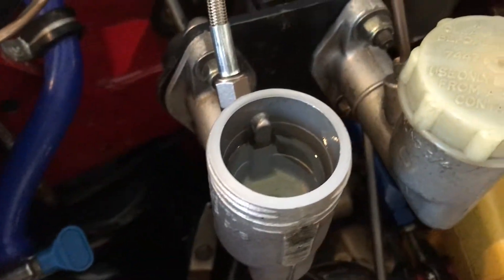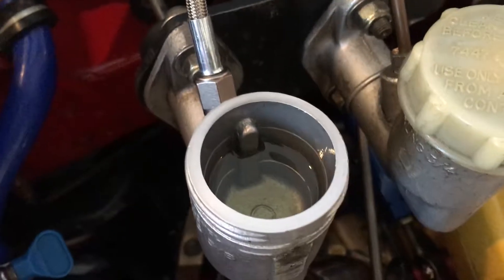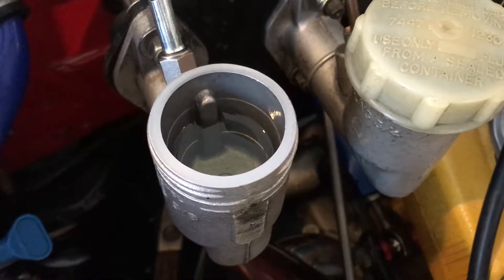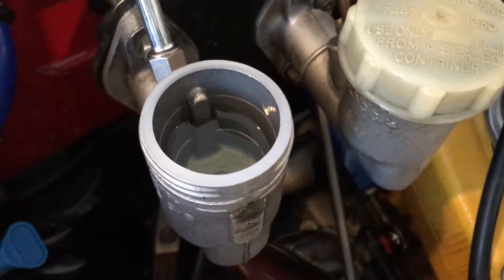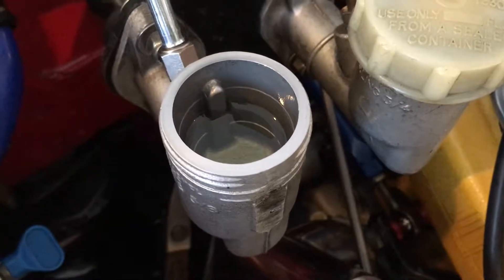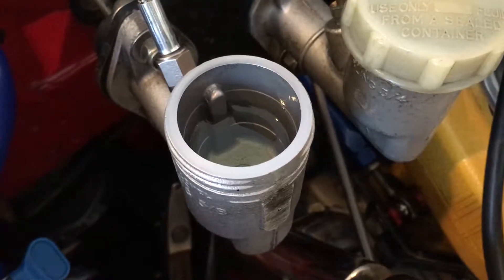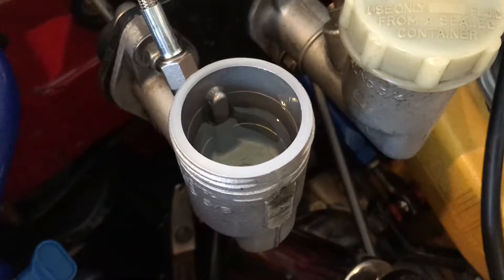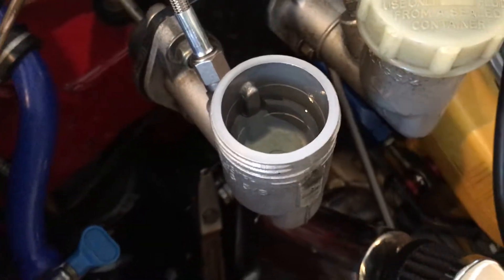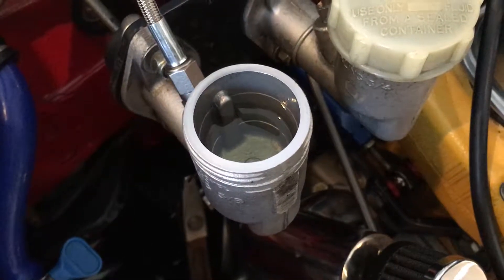I put the brake bias valve in line and now I'm bleeding the rear brakes. Since all my car buddies are at a race — actually one of them's at a sports car show about 50 miles away that I wish I was at — I don't have anybody to pump the brake for me. So I'm doing the restoration version: I'm letting it drip. Gravity feed. It takes about 20 minutes but it seems to be working just fine.